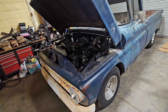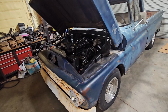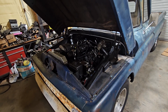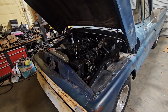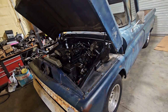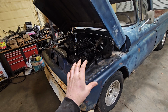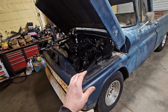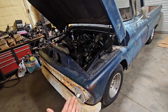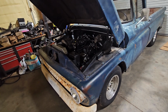I'm going to try to utilize the system as it is, and put in the flex fuel, and see where that gets us. There is one station within 10-20 miles from here where I can get pump E85, and I'll give that a shot for now. That way I can drive it around on pump gas, not have any spark knock, and have a good safe tune in it. And then I also want to be able to turn it up if the need arises.